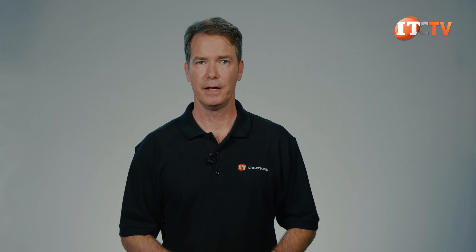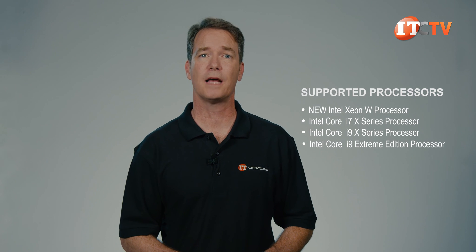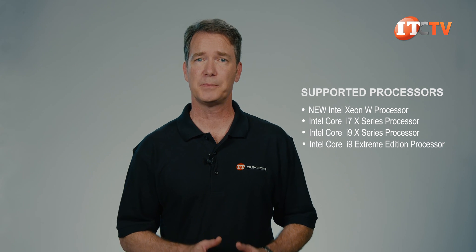The HP Z4-G4 is HP's best-selling performance workstation. It doesn't use the dual Intel scalable processors like the Z8 and Z6-G4, but it packs plenty of punch when outfitted with Intel Xeon W processors or the tried and true Core X i7 and i9 CPUs. The Intel Xeon W processors are designed specifically for single socket workstation applications. They don't even have an ultra-path interconnect like the scalable processors do because there is no other processor to communicate with. Your choice of processors, either the new Xeon W or Core X, will determine component support on certain things like memory, storage and PCIe lanes.